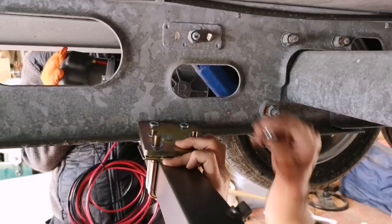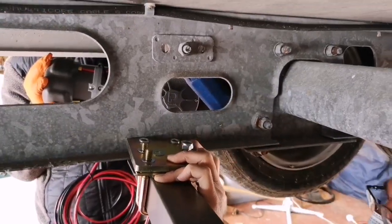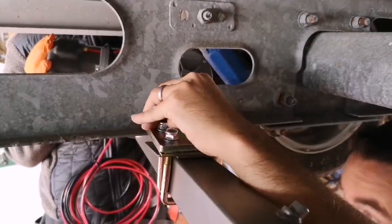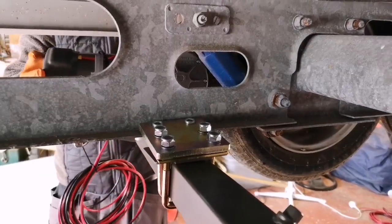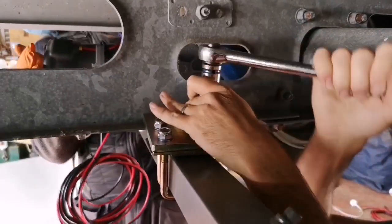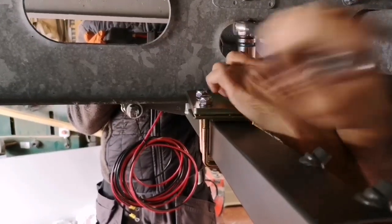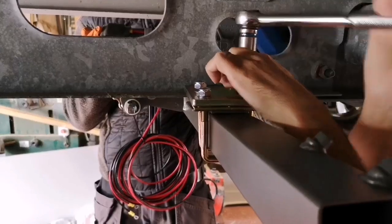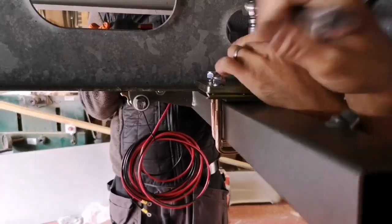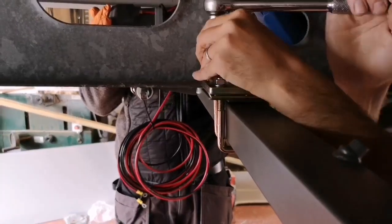And then we can start getting our bolts or our nuts tightened up. These are 17mm, and we can literally just do one at a time. We'd normally use an air wrench on these, but that's just going to be a little bit noisy, so we're going to do it manually. And I'm just going to take the pressure from down, get the other side done up.